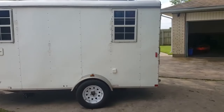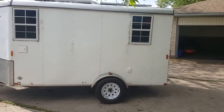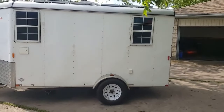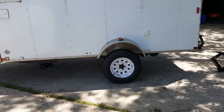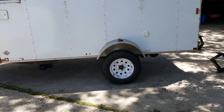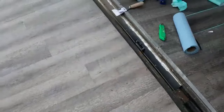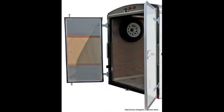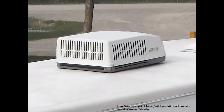The next thing to consider is a trailer lift. Cargo trailers are built fairly low to the ground. If you're going to put tanks on it or go to any rough terrain for camping, you'll need to lift the trailer up. An axle flip kit is very easy to install and very cheap, or you can have it installed before delivery. You might also consider a ramp door versus cargo doors in the back. My wife prefers cargo doors; I prefer the ramp door — she doesn't like lifting it.